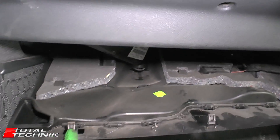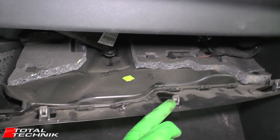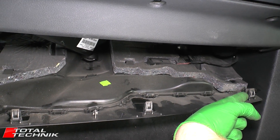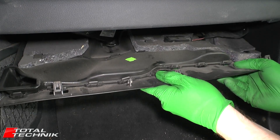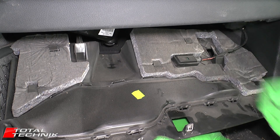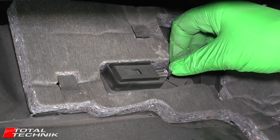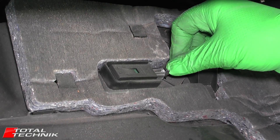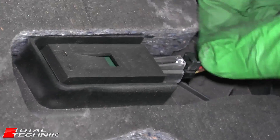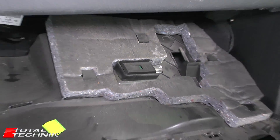Here are the clips — there are three dotted along the top edge just here. Next, carefully slide the rear of it out, moving the whole thing towards you. Then disconnect this little connector for the light. There's a little tab on the end — just push the tab down, give it a wiggle, and it will come out, allowing you to remove the panel from the car.